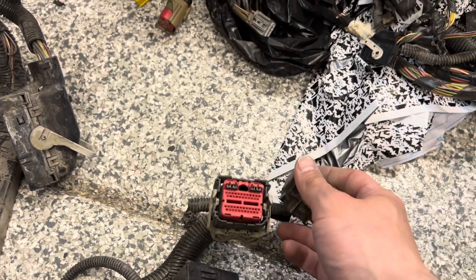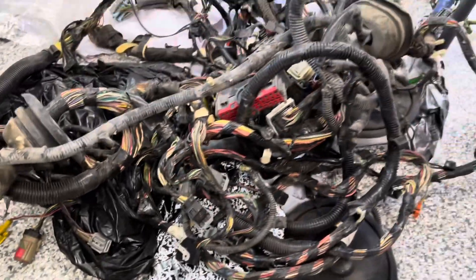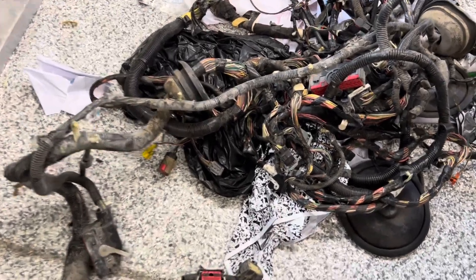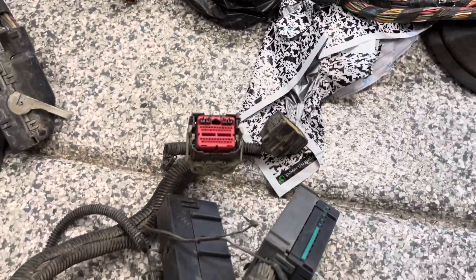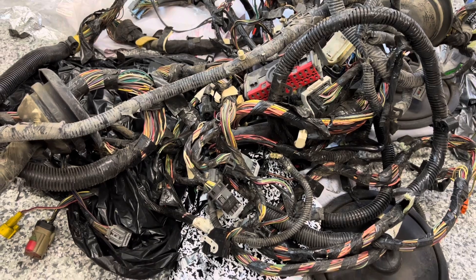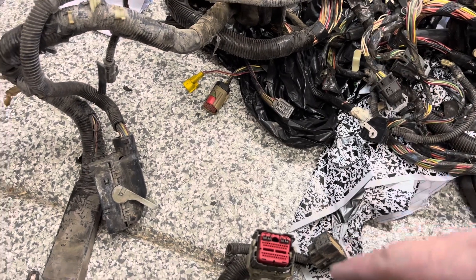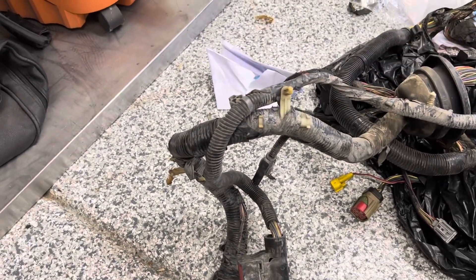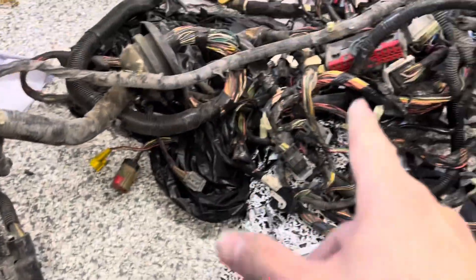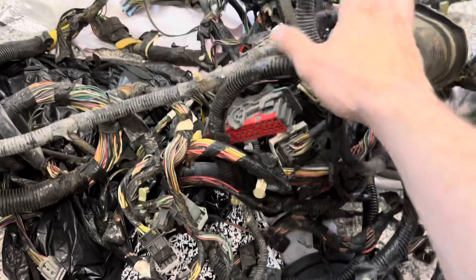I have my reference book so I'll know exactly what I'll need. All the other extra stuff is not needed. It's a lot of bulky work just to get to the relevant part. Since he doesn't have the under-hood engine harness, I was going to try to match where the MAF would go and the AC line, but I'll have to approximate those. The low pressure AC switch should be findable — it should be on the plug coming back out, probably over here somewhere.